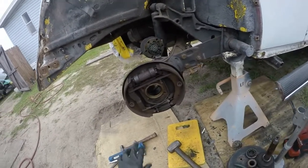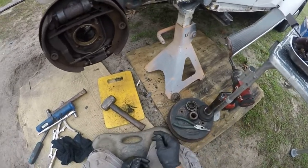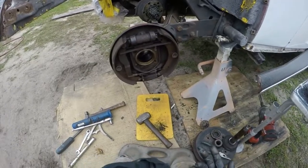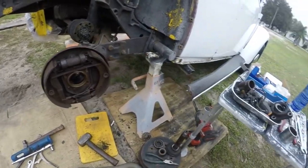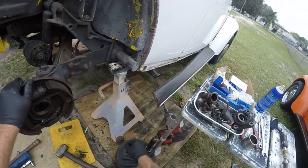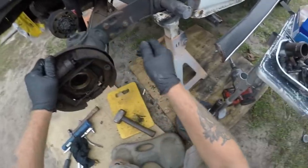I've got the inner and outer bearing out, cleaned up most of the grease, got my surfaces cleaned. Still gotta extract the bolt — same story on the other side, but not as much movement. The race just falls out of it. This could have cracked the casing on the transmission — you're hauling down the road and all of a sudden it releases. We do have a three-wheeler in the house, the 1975 trike, but I don't think this would be a fun ride with three wheels.